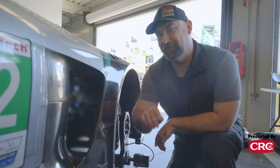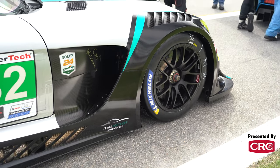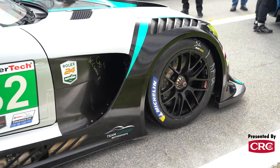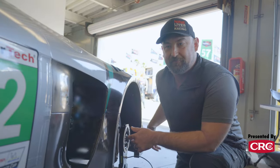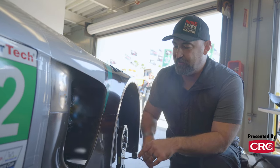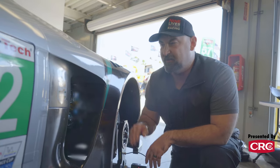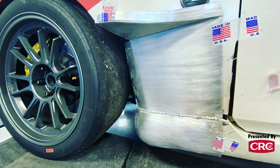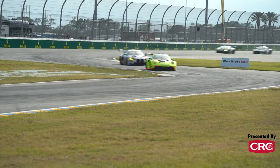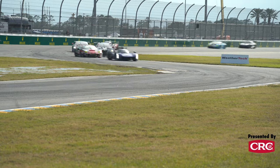Number three on our list comes after the splitter: fender vents. When you have a splitter making downforce, air gets trapped and shoved through. A lot of manufacturers will have these big vents to remove the air coming off the splitter and pull it out the side of the car. On your car, we always recommend directing it a bit more to the side to allow that air to come around as best you can. The easiest way is to just cut a hole, add a little sheet metal around it, and you're off and rocking. These vents can make a tremendous amount of downforce — when we tested it, they increased the splitter's performance by almost 15%, which is a lot of extra front downforce, and front downforce is very hard to get.